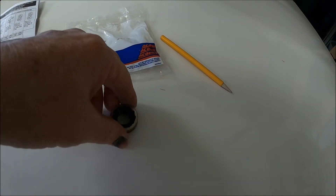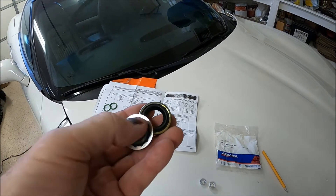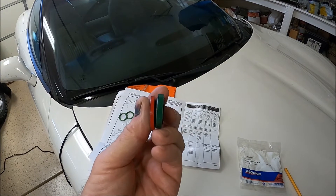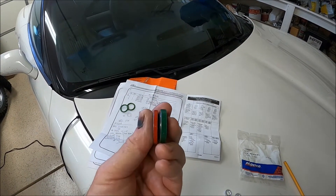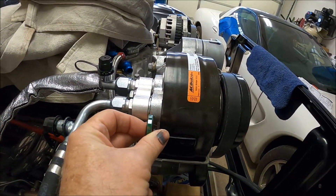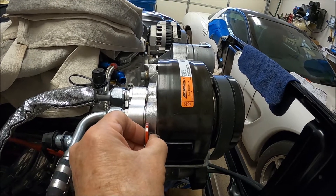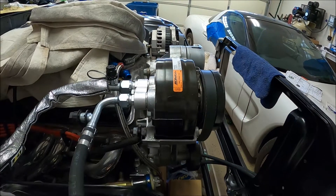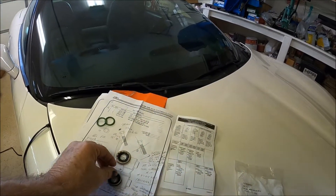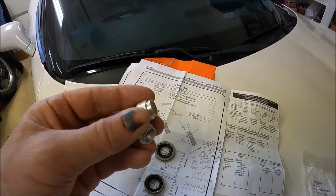The next thing I had to decide was which one of these washers to use on the discharge. They both have the same outside diameter and the same inside diameter as far as the rubber seal, but where they differ is the thickness. On my particular R4 compressor, because mine has the deeper recess, it was the green one. The red one was just not thick enough — it sat flush and you wouldn't get any sealing on the rubber. So the green one goes on the discharge side. We're not going to use the O-rings or the collars.